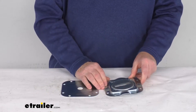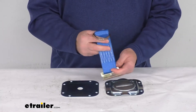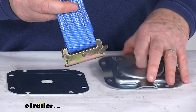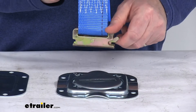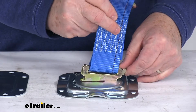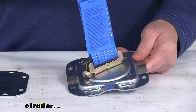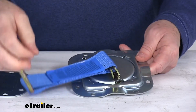For a demonstration, I've pulled out a D-ring E-Track strap, which is designed to hook to your E-Track system. This here would be your swivel plate. You can see the E-Track with the lever — you just lift up on the lever, slide it in, drop it, and when you release it, it locks into place. As you can see, it moves 360 degrees, so whatever angle it's at, it still keeps your strap straight.